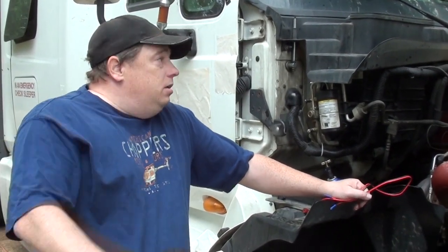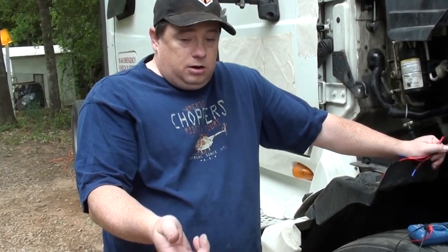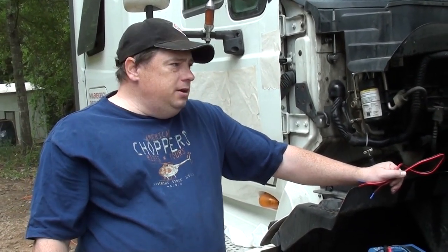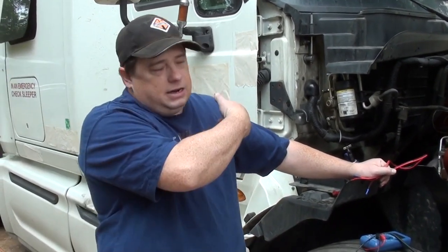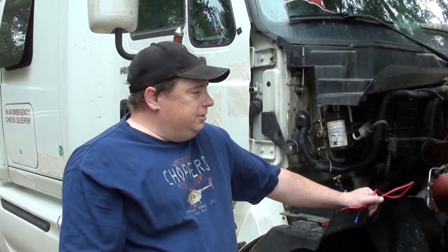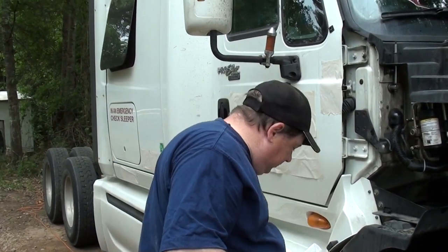So you go in your truck and either reset it, if you know how to reset it, or if you don't have a circuit like I put in my truck, you shut the key off, and you wait 30-45 seconds, you turn the key, let it do its click clack, start up, crank the truck, run back out here with AC on max, and blower going and everything. And just wait about 30-45 seconds. If there's enough pressure in the system, it'll kick on and run. One of these cans, I can tell you for a fact here, you think, oh, how much do I have to put in to get it to recognize it?